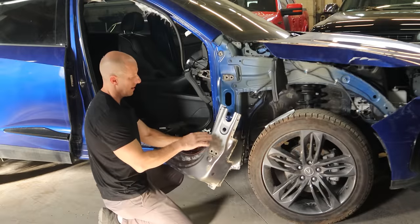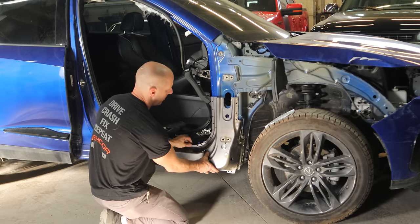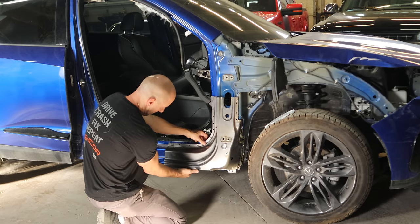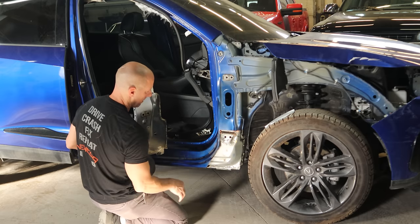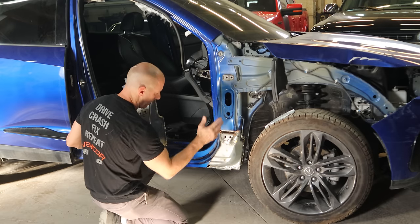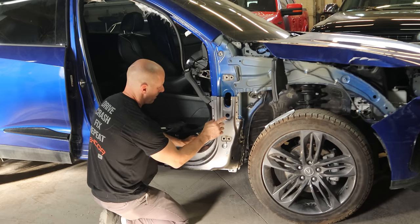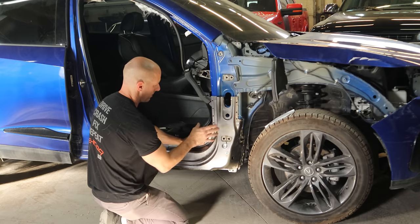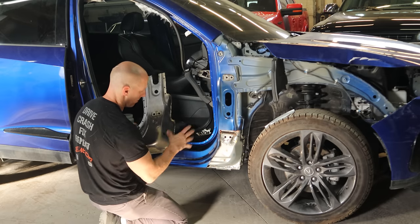So we have our new piece — I cut a lot more than I actually needed, since it's easier to cut extra and trim it down later than add to it. We'll find a good place to put it, somewhere between the welds and the holes on the bottom. We're also going to change the inside piece because that dent would bother me — it's only about seven welds, so we'll pop those out, put our new one up, and weld it up. We'll use the trimmed piece as a template to mark the actual car — no measuring required.